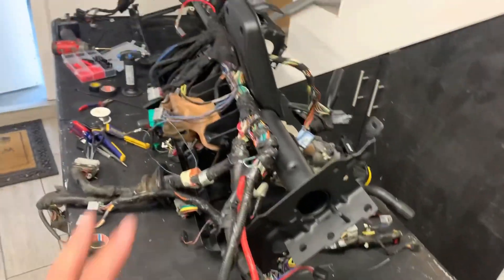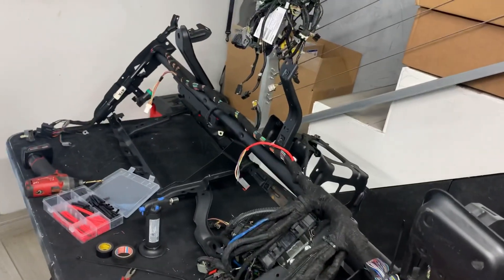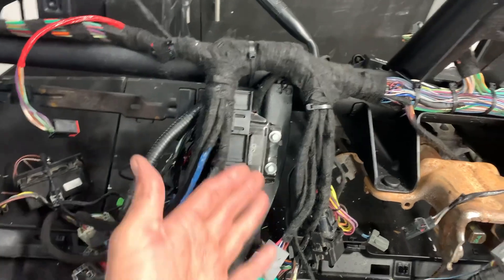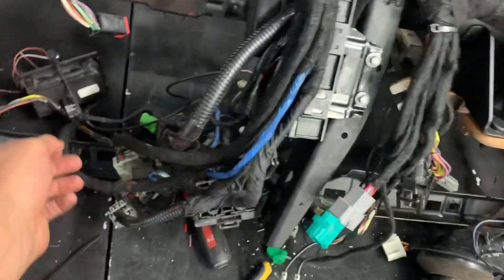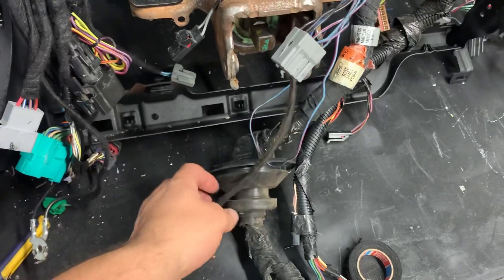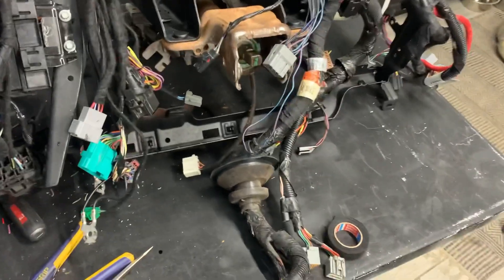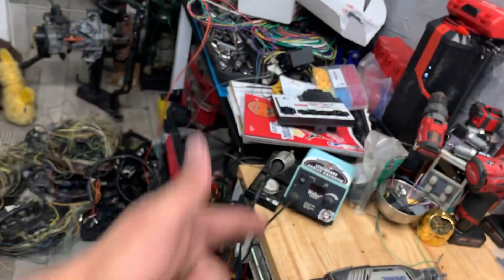This part took about four to five hours. I spent at least an hour or two just on the upfitters - they're 2012 upfitters, but I was able to rewire them to the correct lengths to be mounted here, and now they're plug and play. They go right here to this old plug, so they're gonna plug into the 07 fuse box like factory. So we're basically running 2012 upfitters off an 07 fuse box. Let me start peeling this tape off and get that bad boy mounted.